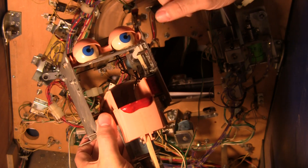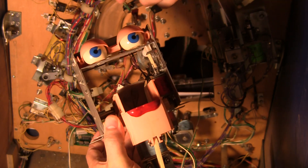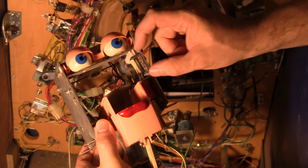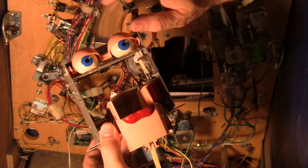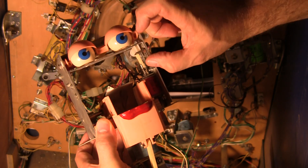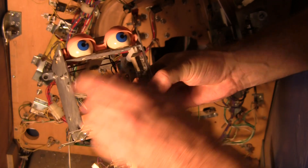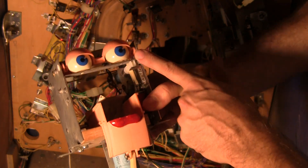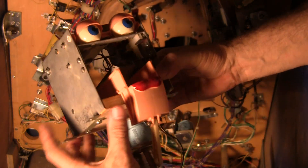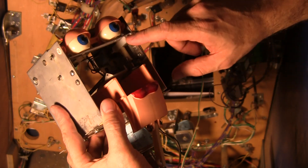In case you need to remove any of these parts here, you can just kind of bend it out. But to separate the eyelids from this plunger here, you really need to pull this thing out and then move this whole assembly forward a little bit, and then you can arrange the eyelids. The eyelids are attached to this plunger up top here. You have to pull the plunger out a little bit, and then twist the eyelids a certain way, because it's like a notched thing. The way to getting into it that I found is removing this bracket right here. I originally thought if I undid all the coils I could pull things out from the back, but it's much easier to do it from the front.